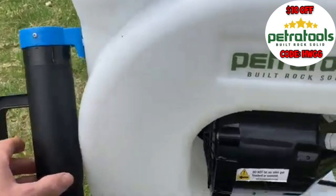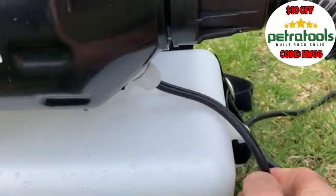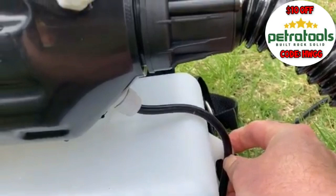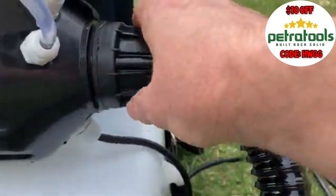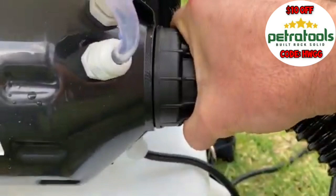One other item to pay attention to is the AC power cord — you don't want it tugging on the motor at that white connector. I recommend taking a cable tie and attaching it right to the base of the backpack unit. You'll also want to make sure all of your attachments are fully tightened. A loose one was causing me problems, with spray dropping out any time I lifted the fogger above my waist. But as long as those are tight, everything works great.